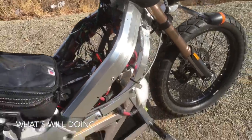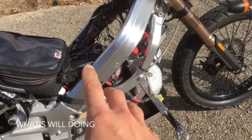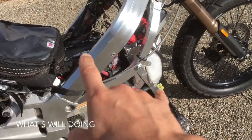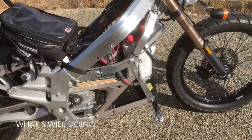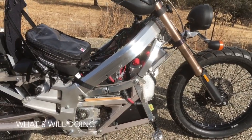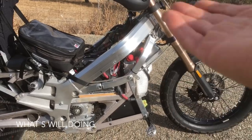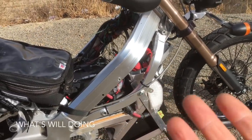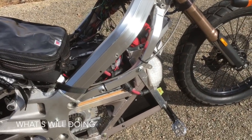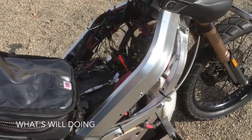Something this bike is really missing is a BMS — a battery management system. Right now I have to manually go in and balance all the cells. So far they've been staying pretty much right on. I've cycled this thing maybe five or six times in terms of actually running it and using it down to about halfway or so, and the cells basically stay matched. I had to do a little bit of balancing right when I set up the batteries, but they're staying in line — and I do check them.